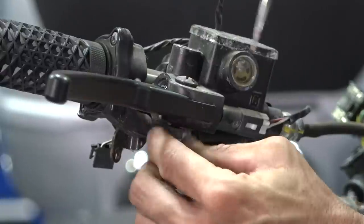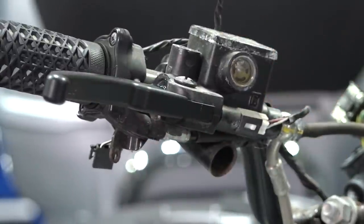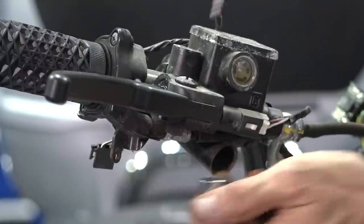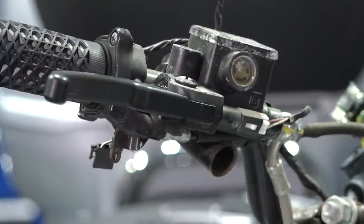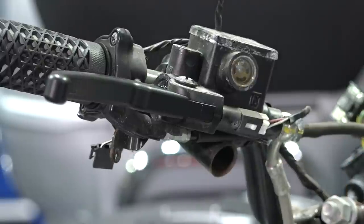While you're at it, make sure your brake light switches work — corrosion can take those out over time or they just fail. I've covered the brake light switches in the past; there are two different types for the Vespas. Even without the dash on, we can turn the bike on, see the brake lights come on, and push the piston to make sure this one's working.